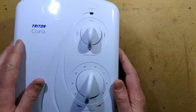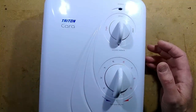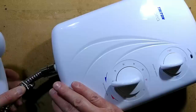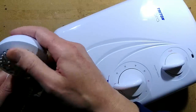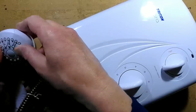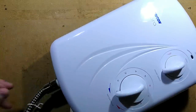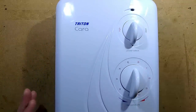For fairness, we do have electrically heated showers in the UK and it's a really common thing. You've basically got a unit that mounts on the wall inside the shower with a mains feed of 240 volts and a cold water supply, with a hose coming out the bottom to the shower head with rubber nozzles on the front. The reason those jets are rubber is so that any buildup of calcium will crack off when you rub them, keeping them clean. So let's take a look inside this unit — let's take it completely to bits, because that's why I got this particular unit.